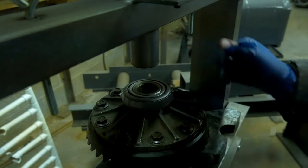So I've gone ahead and put the shims in their proper spaces. I took the 2.45, put that on the left side, put the 2.25 on the right side, and all I'm looking for is I'm holding the pinion flange as tight as I possibly can. If you want to put this in a vise, that would be a much better way to do it, and I did that off camera, but just to show you guys, you're looking for the play. All right, you see, it doesn't really matter where that dial ends up, you're just looking for the amount of play back and forth.